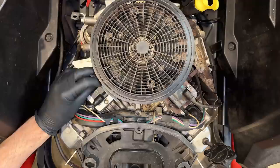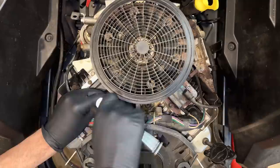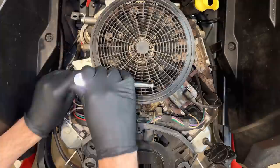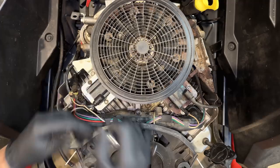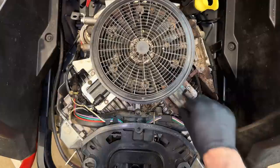Put the card right in there. Should be about 10/1000ths of an inch. Loosen up the coil, and the magnet will just pull it in. Then snug it back up. Don't use power tools for this. And use the smallest driver you have, because these are very, very small bolts. And it's pretty much the same procedure over here.